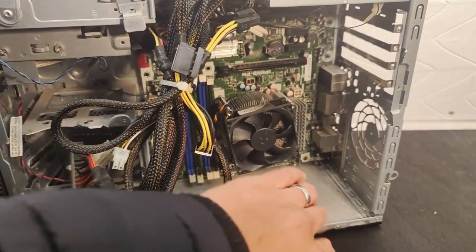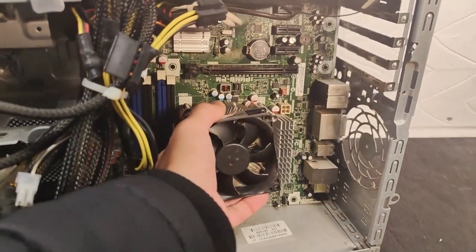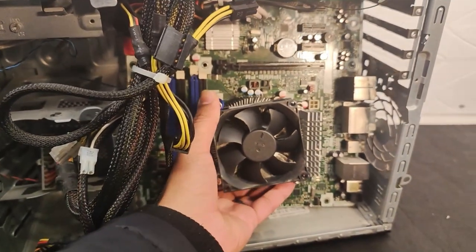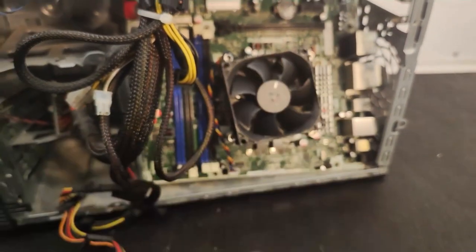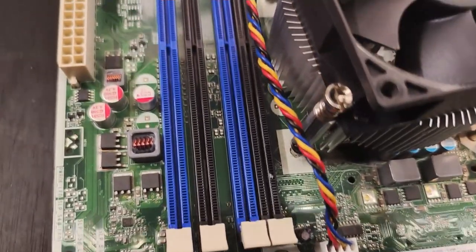Taking out the motherboard — you need to use a size 14 Torx bit and that will help you remove all the screws. The motherboard was fairly tight within this case so I had to wiggle it out the best I could. I probably could have taken the PSU out first which would have made this job a lot easier, but eventually I managed to wrestle the motherboard out.